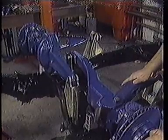This is a typical aftermarket lift kit. The reason I say lift kit is, in our opinion, unlike what we do here at Rancho, this is not a designed and engineered system. First off, I'll show you right here this brightly cadmium plated bracket. One of the problems that may occur from this CAD plating is hydrogen embrittlement, which can cause cracks and fatigues and possible splitting of the bracket.